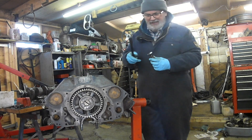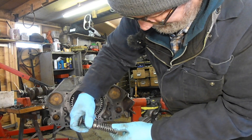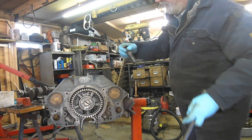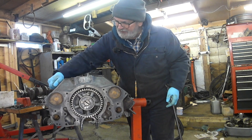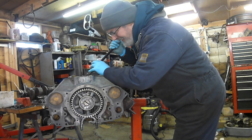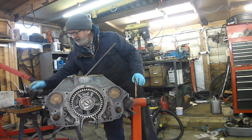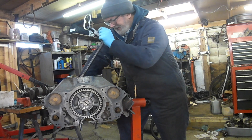Now I'll put the inlet in and show you an alternative way. What you do is you kind of wind the spring so that the grooves there are in line with the coils of the spring. You have to make sure that the split on the guide is kind of in that direction so you've got a groove on both sides. Then you go in like that, line it up, just a very gentle tap — just saves a lot of shoving. Then get your horseshoe clip ready, push, insert, let go. That's it.